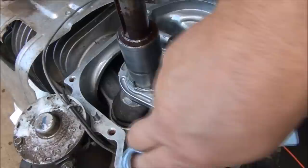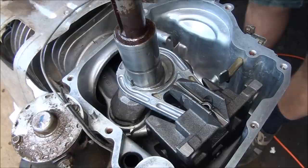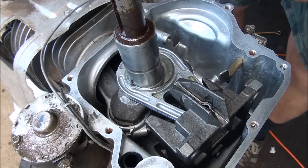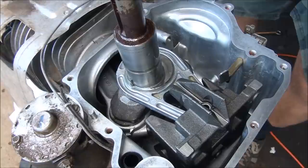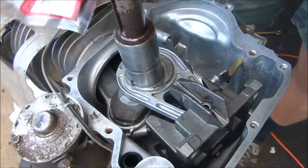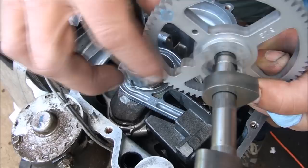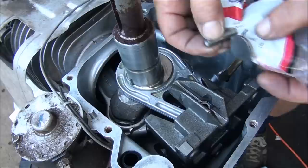You can see a little bit of damage right there from when that can exploded. I think that guy tried adjusting the valves on his own and made them way too tight, because when I went to take this thing apart everything was bound up. Here's the part number for the cam — good old Briggs and Stratton. They give you new lifters, a new oil pump shaft, and a new cam that has a functioning compression release mechanism on it.